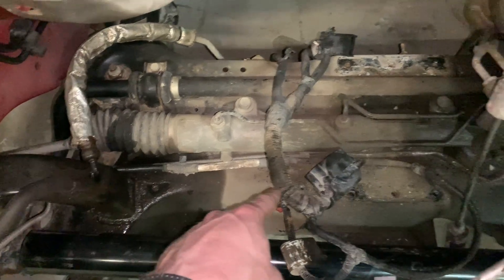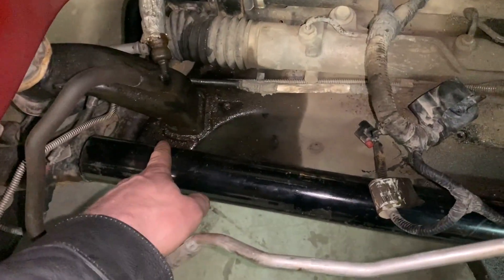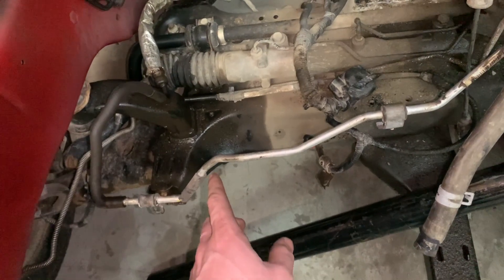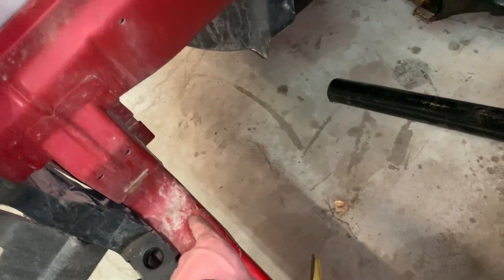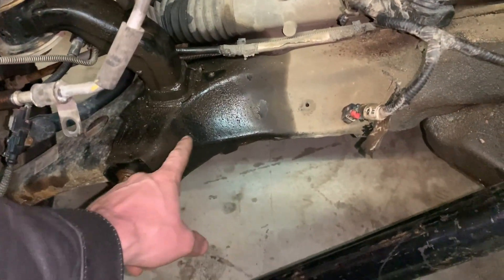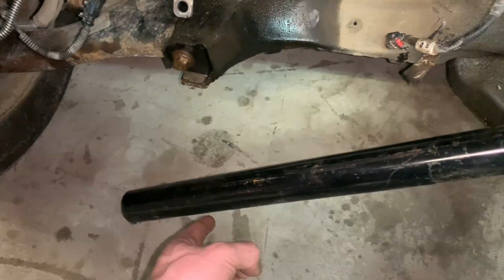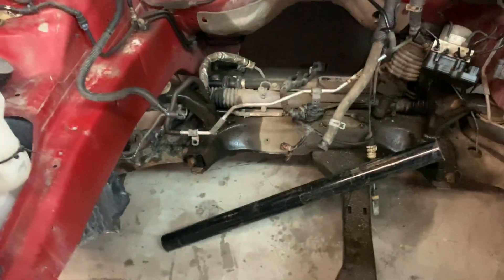I am going to leave the body mount where it goes up, so I'll just skin it out right here, go across, skin it, and take all this big chunk. The sway bar is coming off, the rack is going to be moved basically right up over this. This big beef right here is going, so I do need to strengthen it up. I'm going to get some more steel and tie in the front of this cradle to the frame rail. First thing I'm going to do is make up some brackets so I can take this piece of steel at all different angles and make it one flat piece that I can cut this pipe on a perfect 90 and weld it in. That way I won't have a bunch of different angles at the end of the pipe trying to get it all lined up.